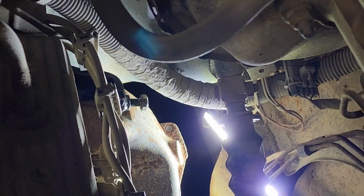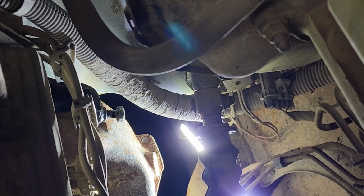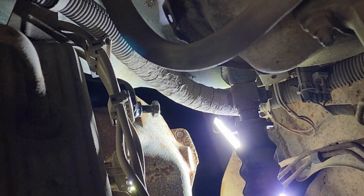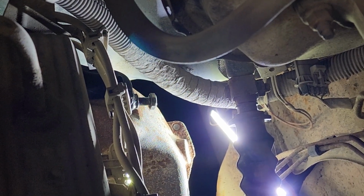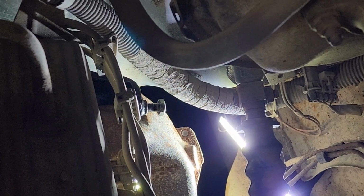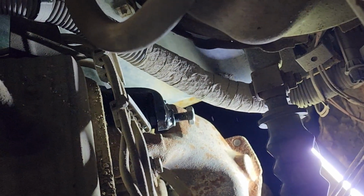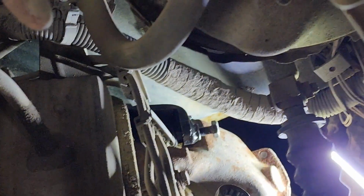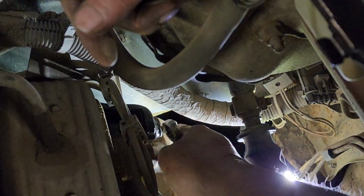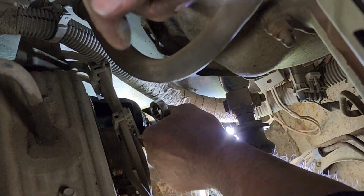Okay. All right, now we're back at the top of a 95 Chevy 3/4 ton pickup with the driver's side rear manifold bolt broken. We're installing the 5.7D kit. We did everything from the bottom. We're up on the top here, and the only thing we really have to do up here is tighten the pinch bolt. So here's the pinch bolt. It is a 17 millimeter head on that bolt, so you have to use a 17 millimeter wrench. Torque spec is about 20-25 foot-pounds on it.